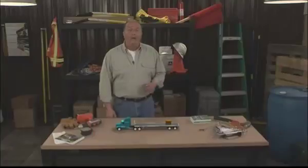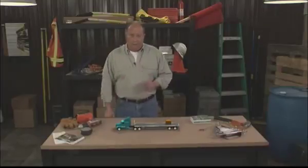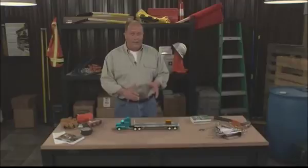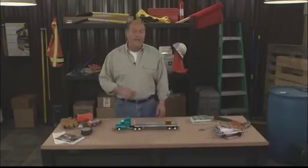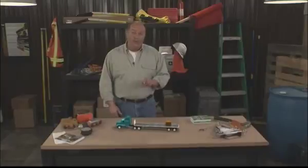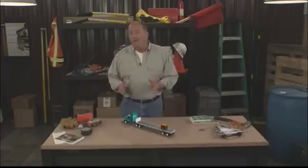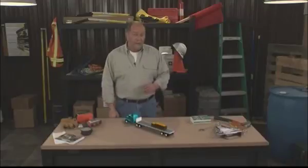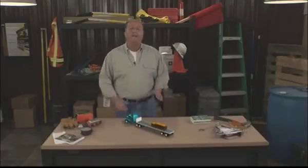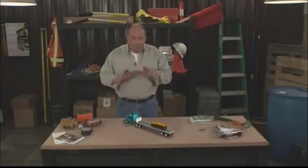What can we take away from all this? Knowing the weight of your cargo is critical to determining both the restraining capacity or strength and number of tie-downs you're required to use, and the way in which you use those tie-downs to secure the cargo. Now you need to figure out whether you might need additional tie-downs due to the overall size of the cargo and its position on the trailer. So, let's consider positioning, specifically whether the cargo is prevented from moving forward.